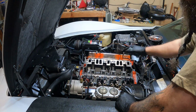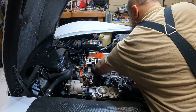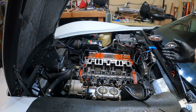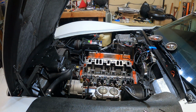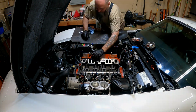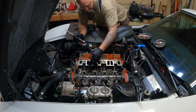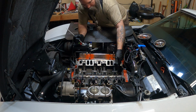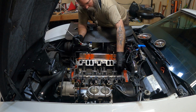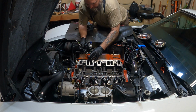Yeah, we'll get that other valve cover off. We'll get something down inside the lifter valley, and we'll start cleaning. Since we were susceptible to dropping stuff down inside, either the intake or possibly the oil return passages in the back of the engine to include the distributor hole, use a magnet for your hardware.